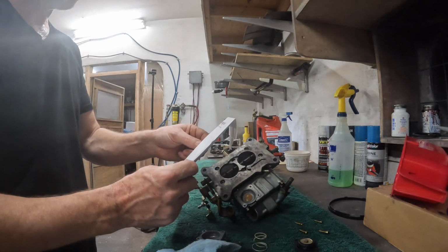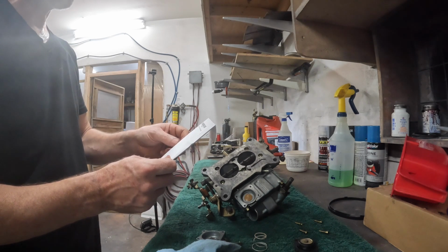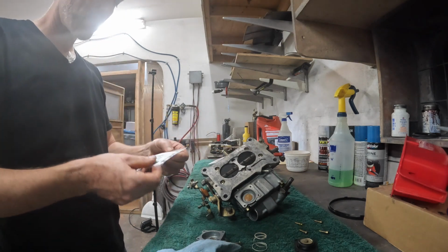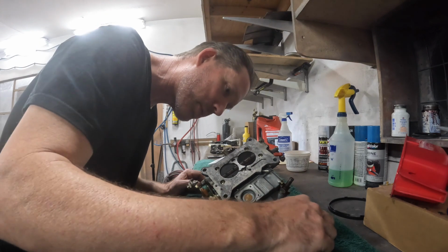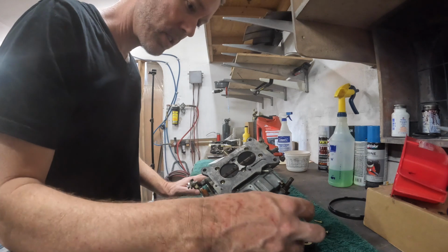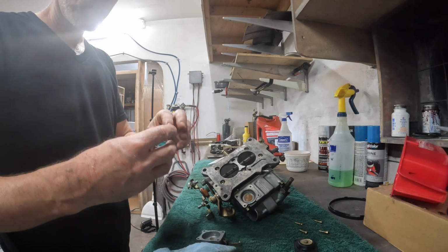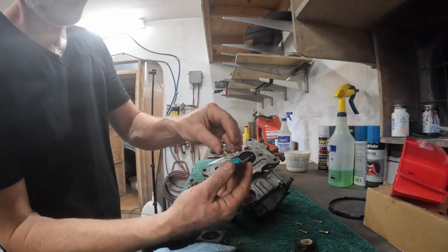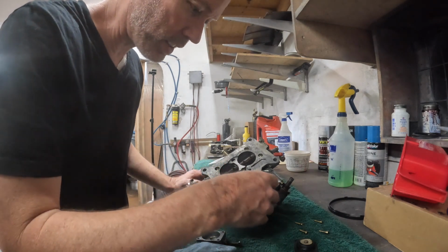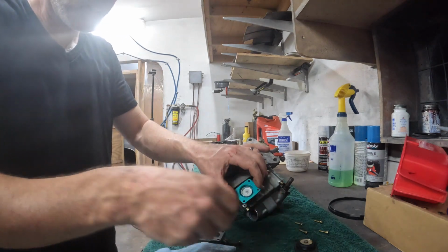This is the one I got. It is a Quick Fuel 50cc G-Fit accelerator pump diaphragm. Seems to be pretty much the same. So I'm gonna go with the spring in the cup because it fits. I didn't actually see it come out, so that's all I've got to go on. Oh, and it fits that way. So I think that sounds right.